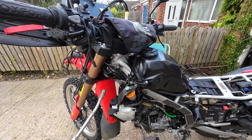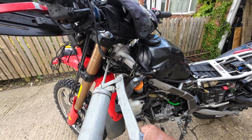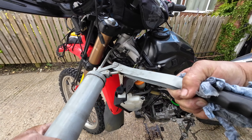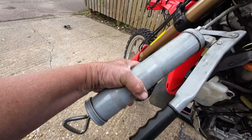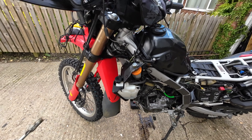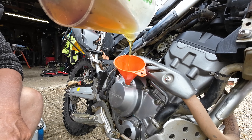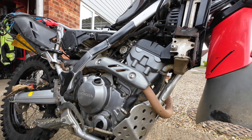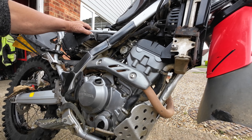Once again, if you're not sure consult the torque settings. I've greased all the rear suspension joints and checked all the bushes. Just got to put a couple of pumps of grease into the front ones - they're starting to come out the bottom. Yep, that'll do.